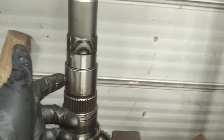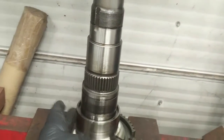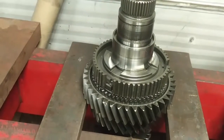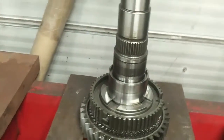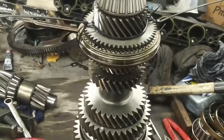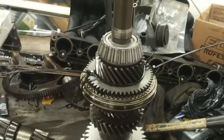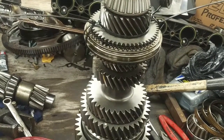Once the output shaft bearing is pressed off, the first gear slides off. The first gear bearing which runs on this race slides off and you remove the synchro. The second gear and the 1-2 synchro are pressed off in the press. I'm working by myself so I have to stop recording to do this. There's the main shaft reassembled with all synchronizers and bearings changed. I put a couple of tie wraps around the input shaft and the main shaft to keep that fifth-sixth synchronizer from falling apart when I turn it upside down.